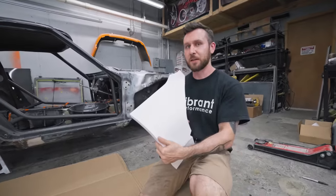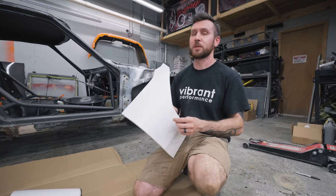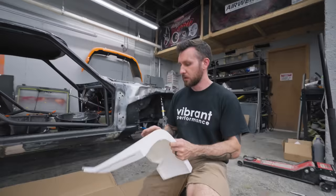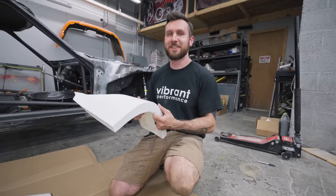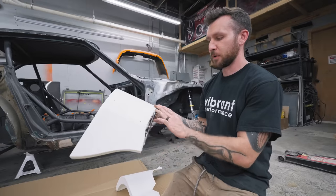We did bump the nozzle up from a 0.4 that was on before to a 0.6. 0.6 millimeters. I don't know what we did with the layer height or anything like that. I just let Will do it. So yeah, it's good. But we had an issue with this print, but no problem.